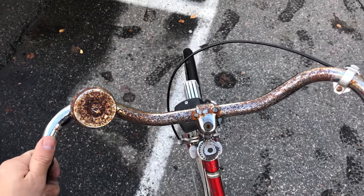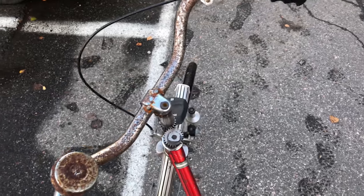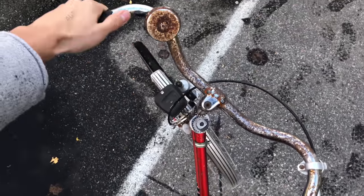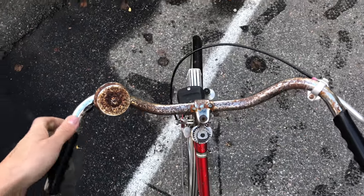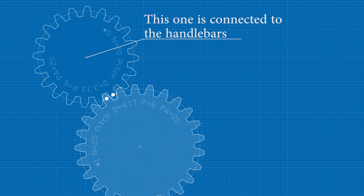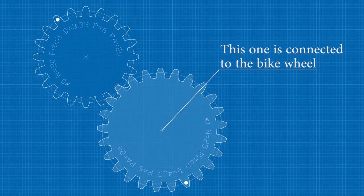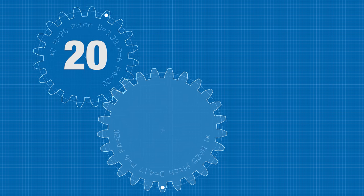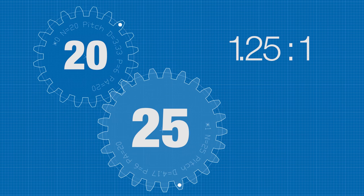So my theory is it's easier. The reason why I think it's easier to learn how to ride this kind of bike with a gear reduction is because in the beginning everyone — myself included — always tends to overcompensate a lot when we feel that we start to lose our balance. Something that more often than not leads to more steering in the wrong direction and even more loss of balance. So having a gear reduction kind of smooths out the steering and makes it easier to learn. Kind of the same way that a car has a gear reduction in the steering wheel, which makes it easy and comfortable to drive straight down the highway. The gear reduction in this case is 20 teeth for the wheel on the handlebars and 25 teeth for the one on the wheel, making up for a 1.25 to 1 gear reduction.